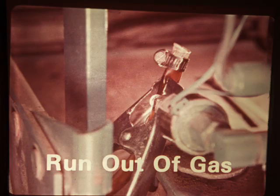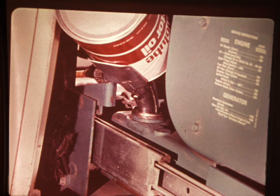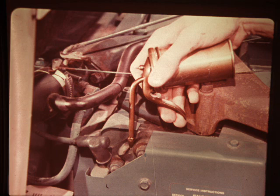Then reconnect the line. Change the crankcase oil while the engine is hot. Attach a tag noting the viscosity of the new oil, which should be appropriate for the temperature at startup time. 20 W SAE oil is recommended. Remove the plugs and pour about 1 ounce of rust inhibitor, or SAE 50 oil, in each cylinder.